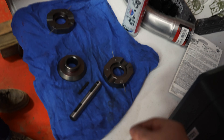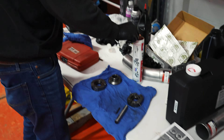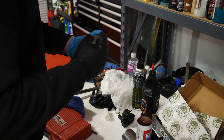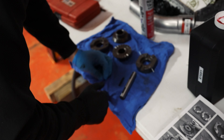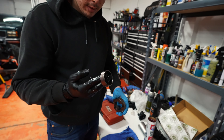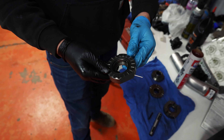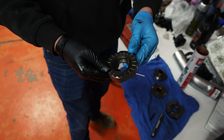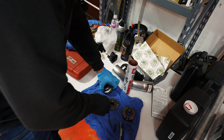These pins go into these divots and these pins go into these divots. I'd highly suggest doing it right the first time, because once you release the pins and the spring pushes the pin between the two, it's going to be hard to get it out. Put a nice thin coat of grease on everything. And then you've got these little cups — we want the recess side, the gear side. The open part of the cup should face the teeth.